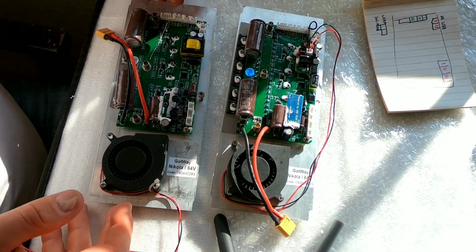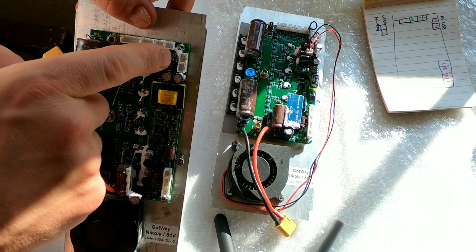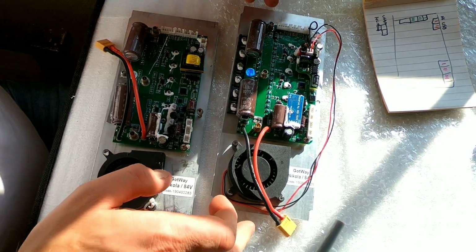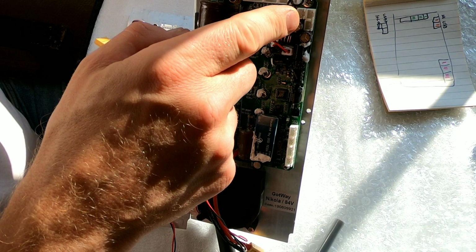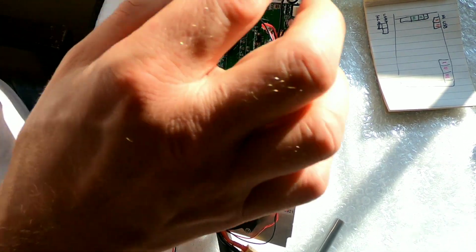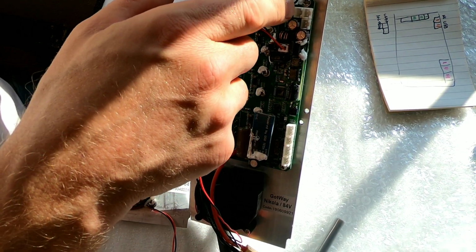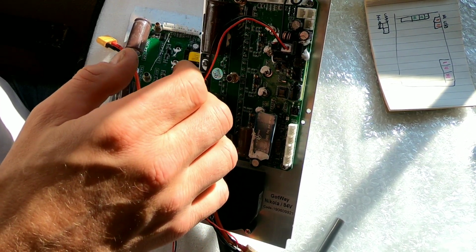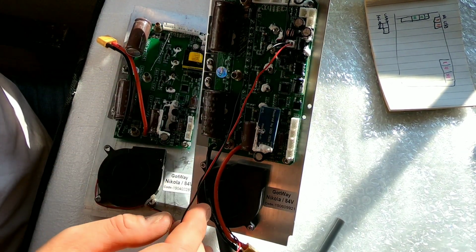And then the one that is actually different. Here on the original board, you have the 2 connectors here, which is the headlight and was labeled as USB. And for the new board, there you go. Hopefully you can see it there, right? So there you now have 3 connectors. Now, if you just take the 2 from the original board and place them in the upper row, that won't really work, since then I've changed it so the headlight is supposed to go there. So it's the one below. And from my reading, these 2 are basically interchangeable. So I'm just gonna put the USB on top of that. So headlight there, and that one, I'm just gonna leave the 3rd one unused.